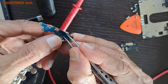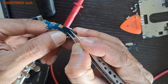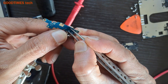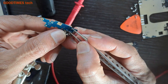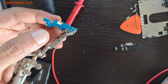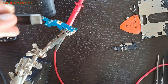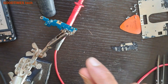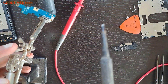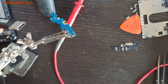I need to solder these terminals once again. I'll scrape the positive and negative terminal tracks on this side. I need to re-solder the sub-board because the pins are not holding the previous tracks on the terminals properly. I've scraped all four terminals — four, because you can use the charging cable in both orientations. If you solder only two terminals, the charging cable will only work inserted one way.